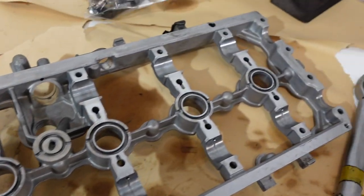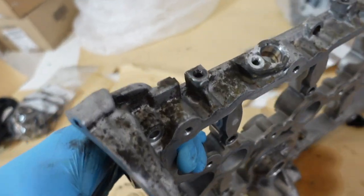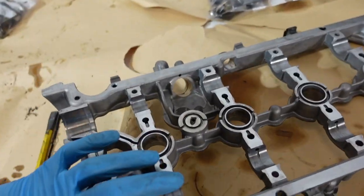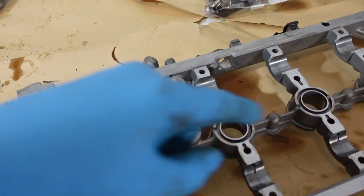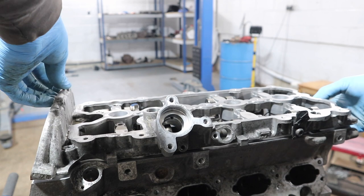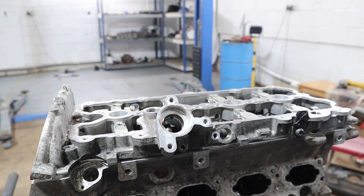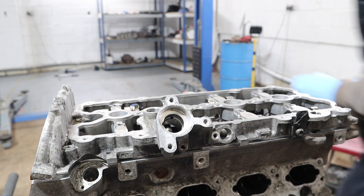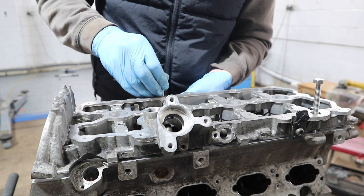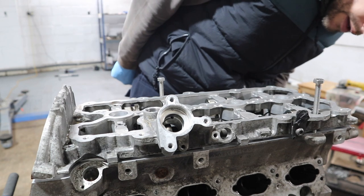The cam carrier is all cleaned up - not perfect but the underside looks very clean, just more stained than dirty now. I'm going to do the same again: engine lube in the divots, put the gasket back on, some sealant around it and get it on. There are two locking pins you're meant to use to centralise the clamp, but I don't have them - two 8mm bolts do exactly the same job.